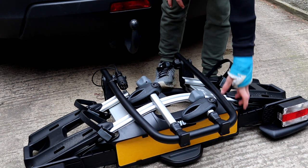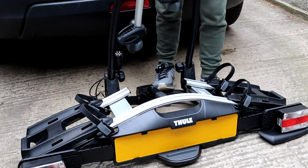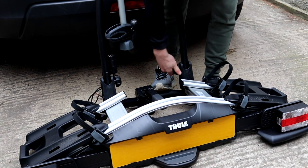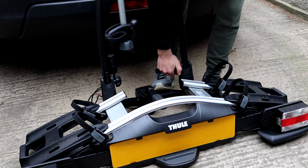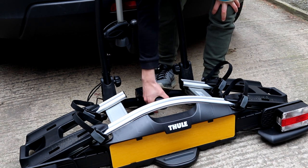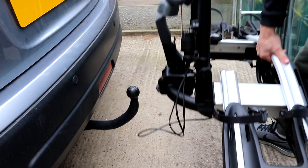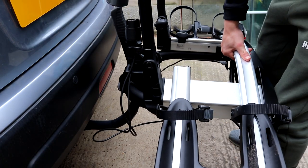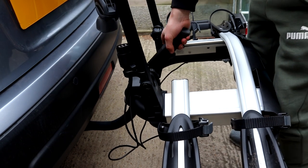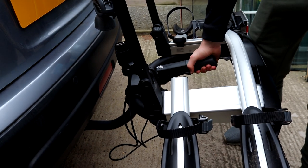What you want to do is stand this little bar at the back, then lift this up and as you can see it knocks into there. You have to lift it up, push it back down, and then tighten up these so they feel tight. There's a little trigger under this handle — push the trigger in and pull the handle up, then lift up the tow bar so the little space underneath the handle sits on the tow bar. Then you can pull the handle down. It takes a bit of force but once it's on it won't lift up.